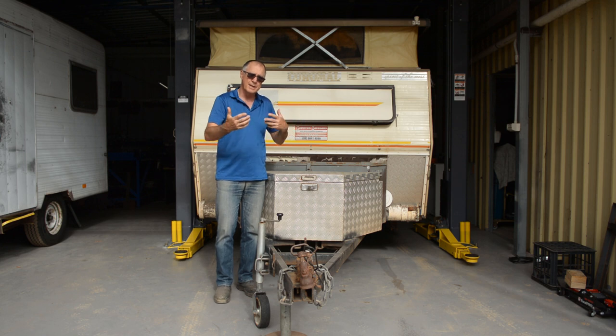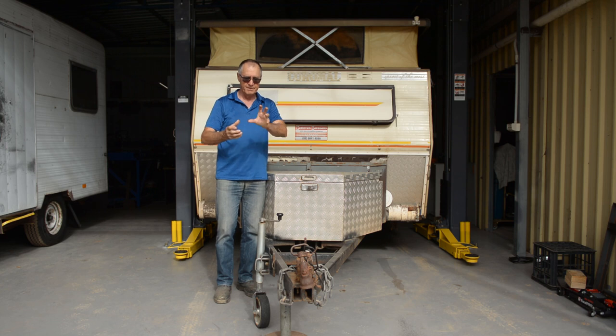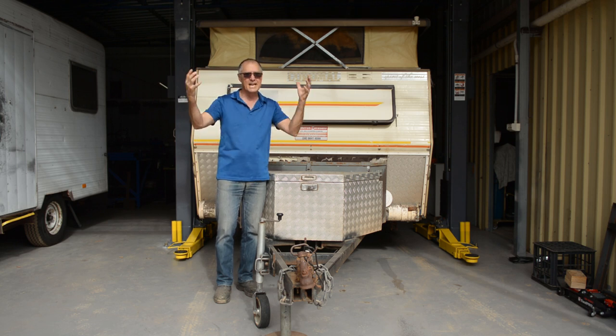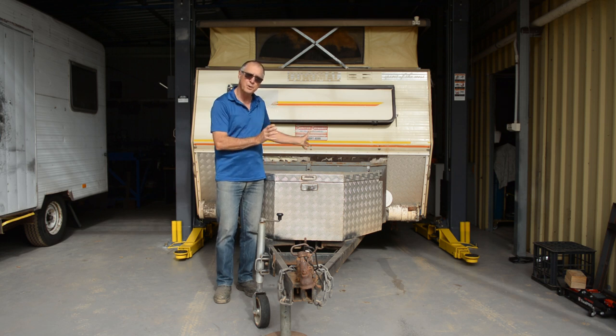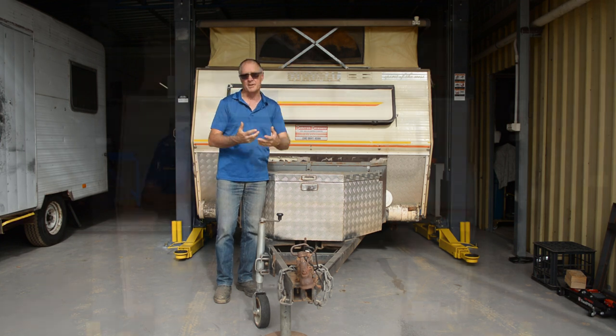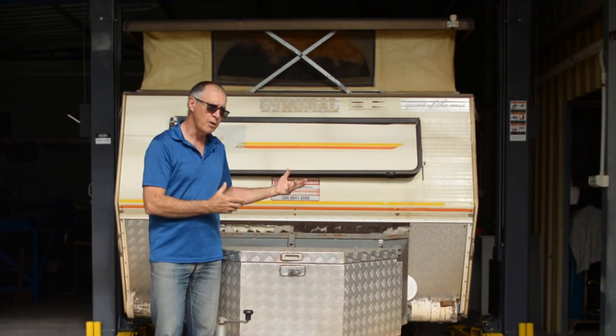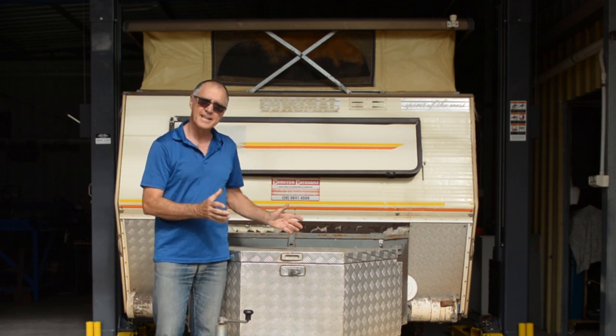I hope you can stick around and follow the video series — maybe you'll have some ideas of your own to share. We will be going off-road, so we need to look at a new hitch — one of those swivel-type hitches that goes up, down, and all around. Hopefully we can get a slightly bigger tyre in the guard for more ground clearance without cutting the guards. We've also got to put a couple of water tanks in — it currently has one, but we probably need two. There's a basic electrical system already, but we'll dress that up with solar power on the roof and get everything sorted before getting it licensed.